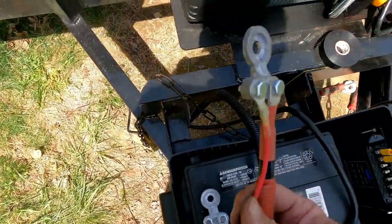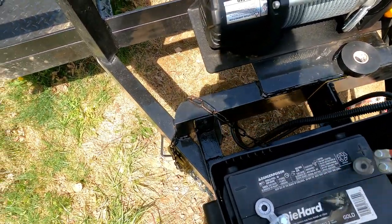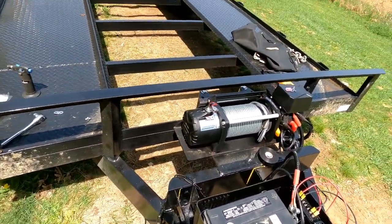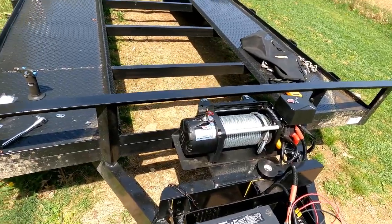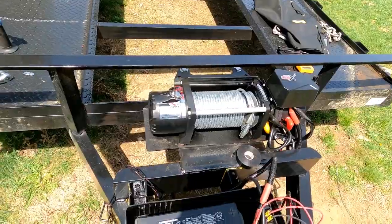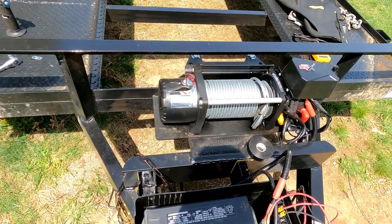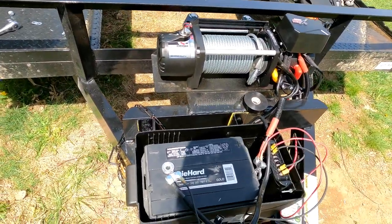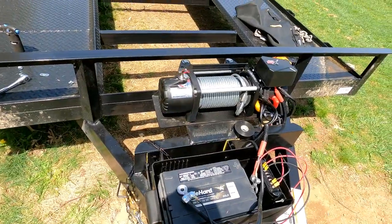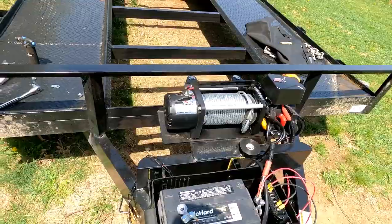The hot looks the same. So we're going to get these on in their respective spots, and then we're going to test the winch. Since this has never been used, I've got to run that winch cable out and then pull it back on under some kind of load so that it winds properly — so that it doesn't dig down into the drum and make a tangle the first time I try to use it. You know, if I don't run it all the way out. So let me get the battery hooked up, and then we'll give the winch a test.